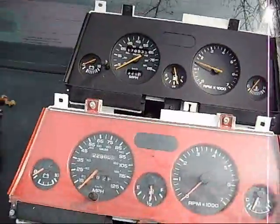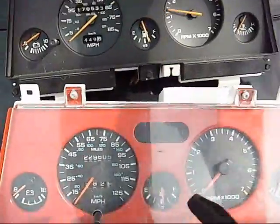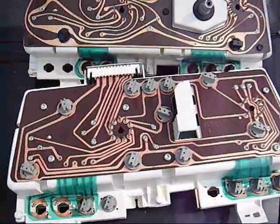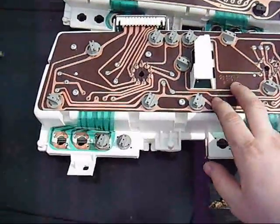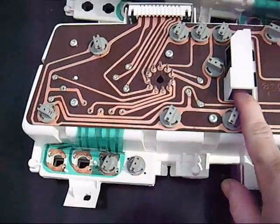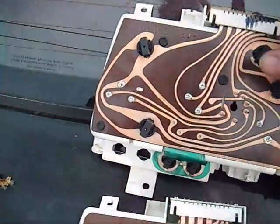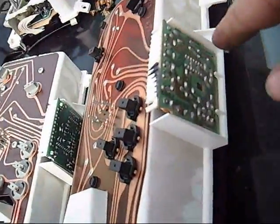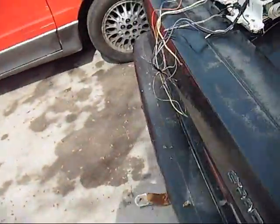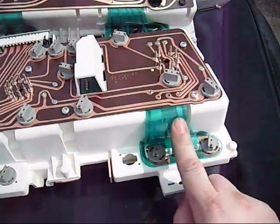You have to pipe those two wires through. Comparing gauge clusters - this is the first-gen Shadow versus the second-gen - the wiring on them is slightly different. This one has a cable speedometer, this one has an electronic speedometer, so the speedometer has its own little circuit board underneath to control it. Both of these, like most gauges, have a little circuit board up top - that's the tachometer module. If your tachometer isn't working well, generally the simplest fix is just re-soldering all the different pins. Over time they just don't work as well. For the signals and things, everything is attached via ribbon cables.